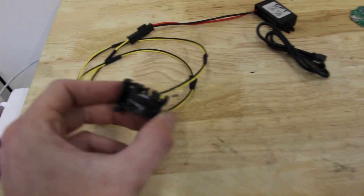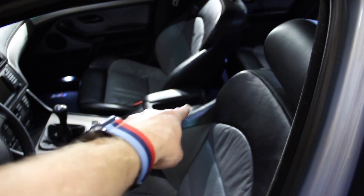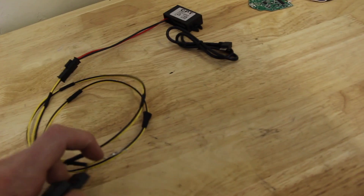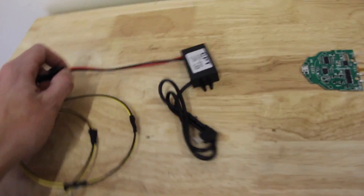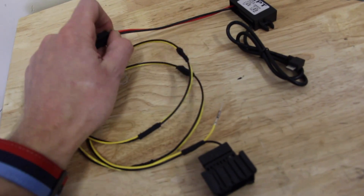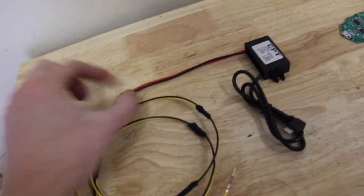This is going to be a little bit cleaner. We're going to be running it to the eject box connector and plugging it in directly to a factory harness — totally plug and play. The eject box connector is going to be under the center console armrest, so we're going to be taking that out today and working with that. The ground is already pinned. I'm going to figure out what pin the positive is, then shove it in the connector and mount that in the eject box. Ted helped me here — all this yellow and black wire, this connector adapter will snap in under the armrest, totally plug and play.